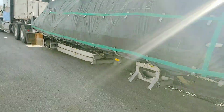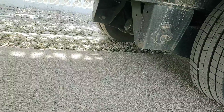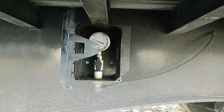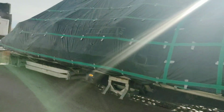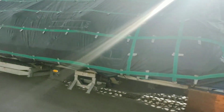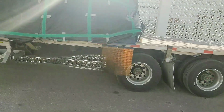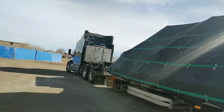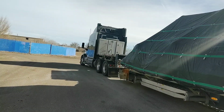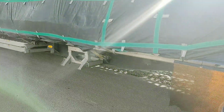The load is not 30,000 pounds like it said on the paperwork. I verified that from my scales right there. I don't even think we're 30,000 pounds on the axles back here. We're like 20-something thousand. When it's at 60 PSI, you're right around 33, 34,000 pounds on the back if you run spread, then it's 20/20. Same thing inside the truck. We don't run spreads on the truck, but 34,000 at 60 PSI. Now, everybody has different applications, but this is mine.